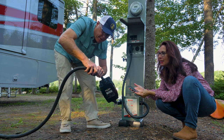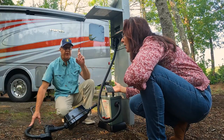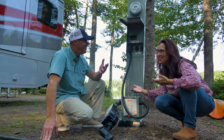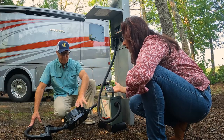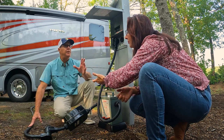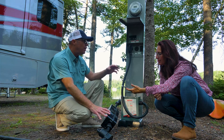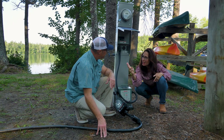Wow, that boosted us up to 126! I'm gonna plug this in — good and clean — now into the RV, and I'm gonna wait to hear it provide power. You can hear it — there you go. Since we have the new RV, it's very important to have both of these. We've been to different campgrounds with different voltage, and it changes over the day as people use their air conditioning. This is gonna keep it at a steady 120 to 122 — that's what we want to protect our RV.